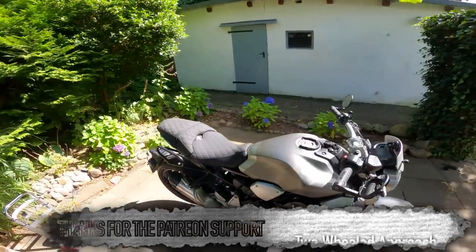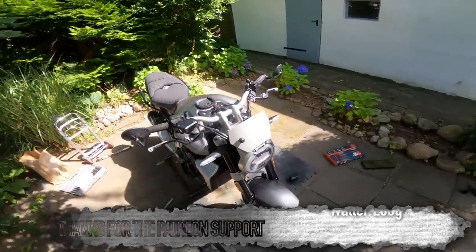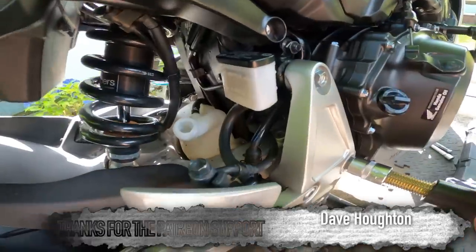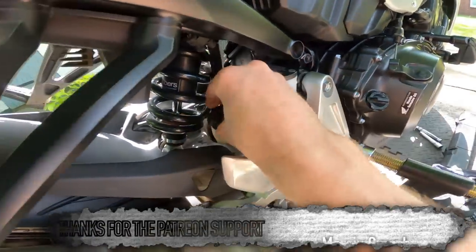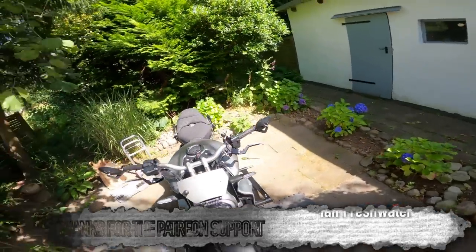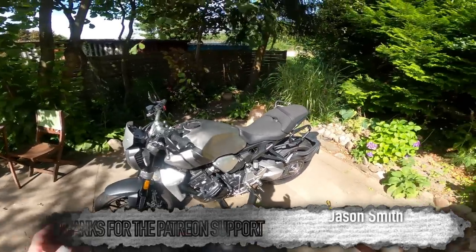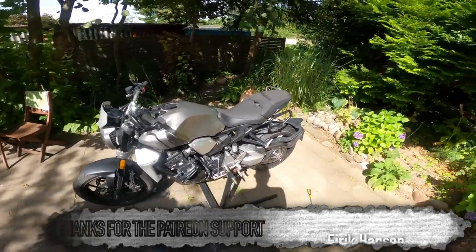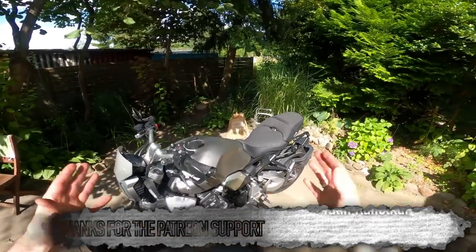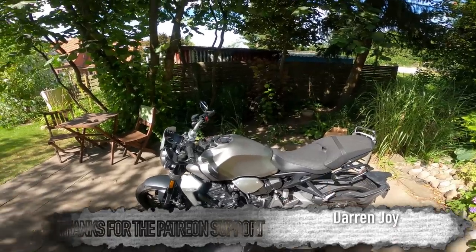That is pretty much it. There are a couple more things due on the 24,000 kilometre service which will officially be due when we get back from Norway - I need to change the brake fluid because that's already two years old. Let's check the coolant, which on this bike is almost impossible to see - yep, there it is, just a tiny bit lower than maximum level, which is good. And that means the service is finished on the Honda CB1000R. Thank you so very much for watching. I am very much looking forward to taking this beast up into the Norwegian fjords, hills, mountains and twisties in just five days time. If you've enjoyed this video, please give it a thumbs up, subscribe to the channel, and I'll see you out there. I've been Andy - keep your shiny side up.